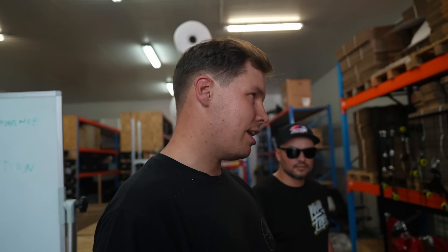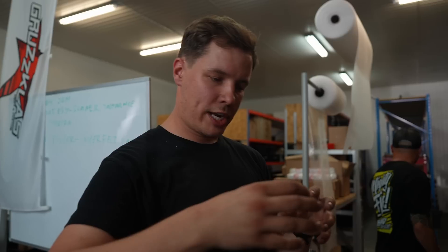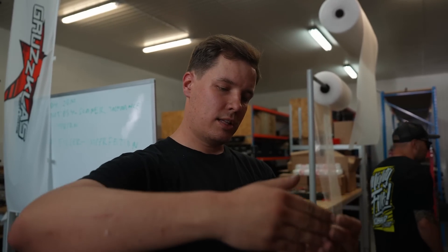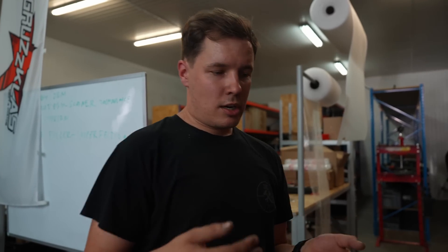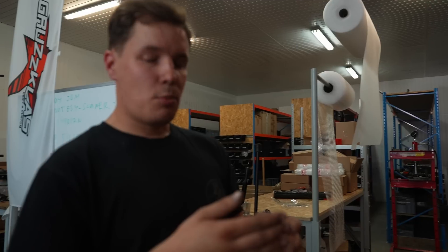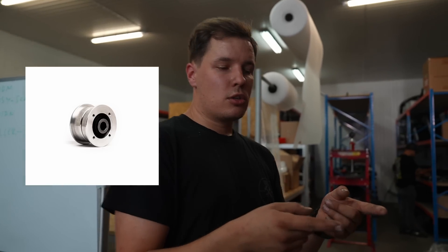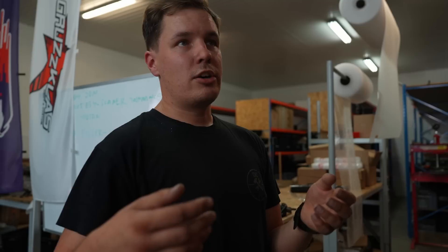We've got a very nice monoball conversion kit for the RTAB on the E46. The arm has rubber bushings in it — when the suspension goes through its travel range, the bushing is not rotating but it has a second degree of movement. With rubber bushings it works somewhat but it's prone to moving around because the rubber is soft. With polyurethane bushings it doesn't move very much and the movement isn't smooth. With the monoball conversion you get perfectly smooth movement throughout the whole travel range.